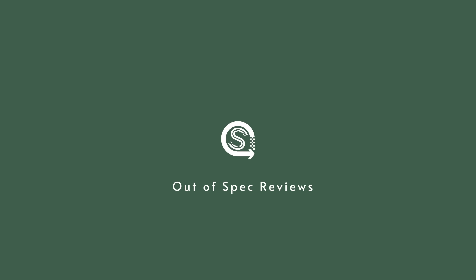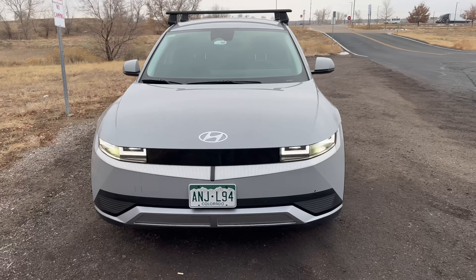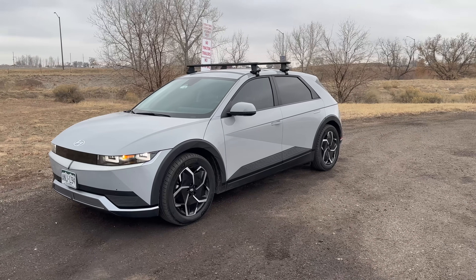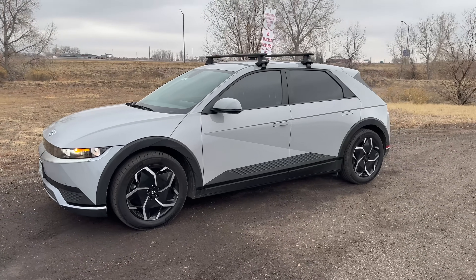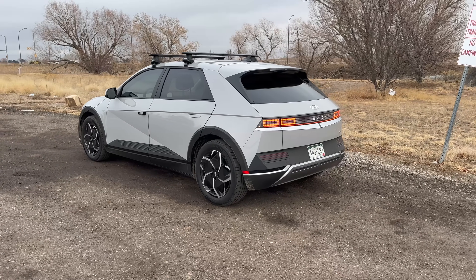It's been a little while since I've driven an Ioniq 5. Let's go try out the preconditioning. Here is a Ioniq 5 SEL all-wheel drive. It's really important to note that this battery preconditioning update is standard equipment for 2023 models. This particular one is my friend Zach's car. His is an all-wheel drive model, which is great because there is a technical service bulletin, a TSB, specifically for all-wheel drive Ioniq 5s — it's not available for rear-wheel drives to unlock battery preconditioning.